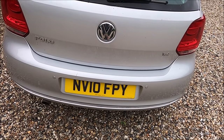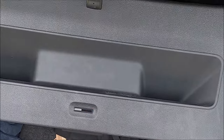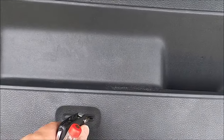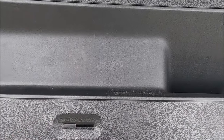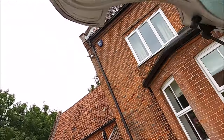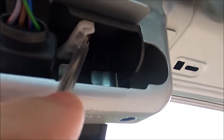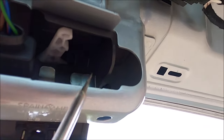Fortunately there's quite a simple and cheap way to fix this. Inside the boot you'll see there's a little slot in the boot lid. All you need to do is put your key or a small screwdriver through the slot and you'll be able to feel a lever. You're just trying to move the lever over to the left-hand side while pushing up on the boot lid, and that will open the boot.